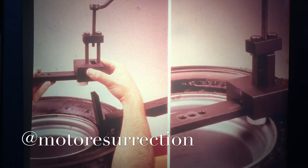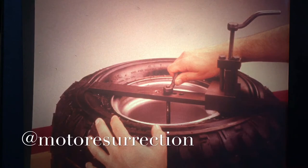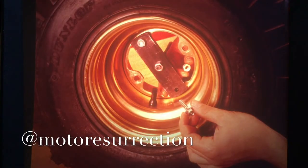Place the breaker press head over the breaker arm press block, keeping the breaker arm horizontal. Back the press head bolt out and position the nylon buttons on the press head against the inside rim edge. On a seven inch wheel, the nylon buttons are positioned on the top edge of the rim. Insert the threaded shaft through the appropriate hole in the press head assembly and tighten the lever nut until both ends of the press head contact the rim.